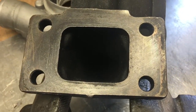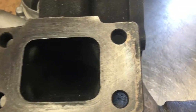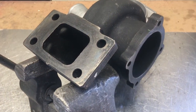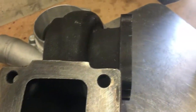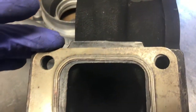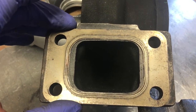When you have a turbo system, you want the gases to flow out as fast as possible — that's going to help with the spool time of the turbo and the efficiency of the turbo. So what we're going to do here is gasket match this inlet of the turbine to match the gasket, and this gasket is also going to be matched to the turbo manifold outlet.